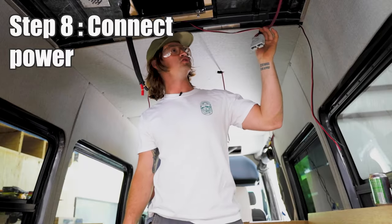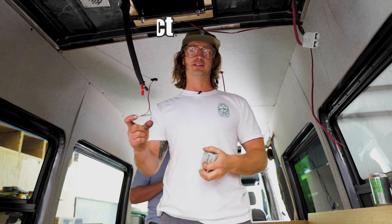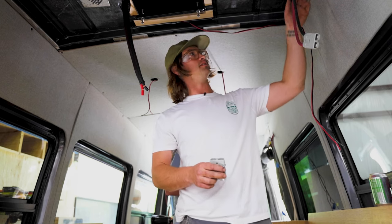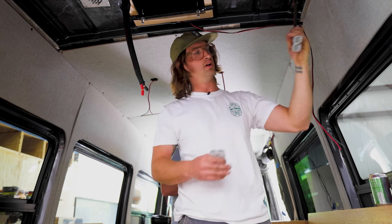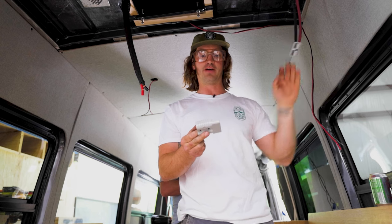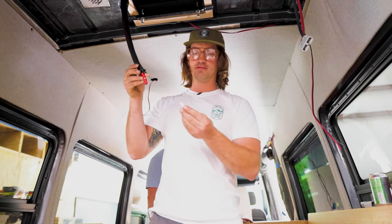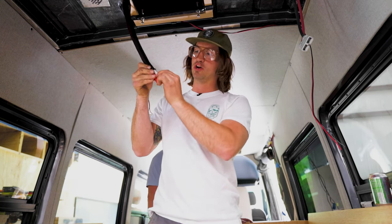We went ahead and ran the two AWG wires through the wall. Nomadic does provide a whole wiring kit — it's protected with some tech flex, which is necessary inside the wall. You want to make sure it is in fact loomed with protection; otherwise friction is going to be an issue and you're going to have problems in the future. We went ahead and put the connection on — it's just a quick connect that makes it super convenient so you don't have to do a splice. We're going to start one at a time, pull that jacket off, and take this connection and run it over top of it.